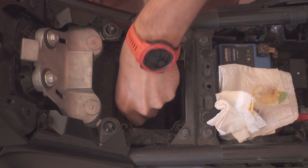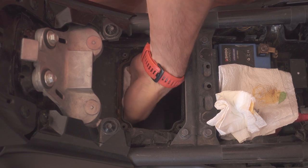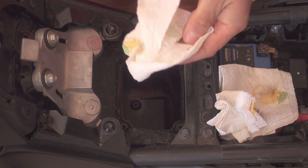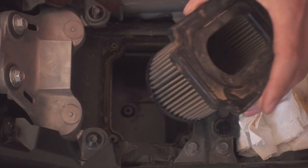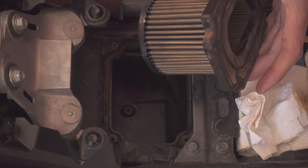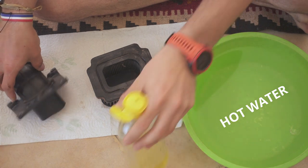I'm going to scoop something from somewhere in the back of the airbox to check. No, it's clean — the paper is white. So let's wash this baby up, get some fresh oil on it and put it back on the bike. Water. Dish soap.